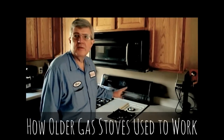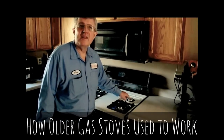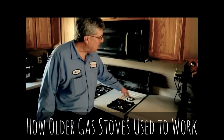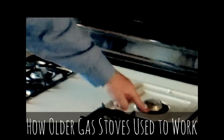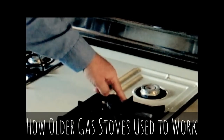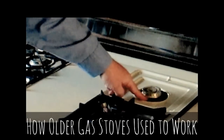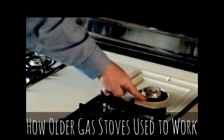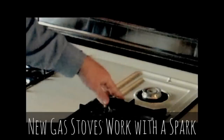Back in the day, when you turn the stove on — a lot of people think this is instantaneous, but it's not — gas would come out these holes here. There are also three little holes in front, and the gas would shoot out, hit the pilot light, the heat from the pilot light would ignite the gas, it would flash back, light those three little holes, and then light all these here. That was how it worked with pilot lights.